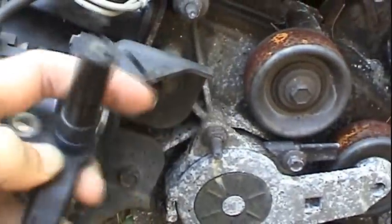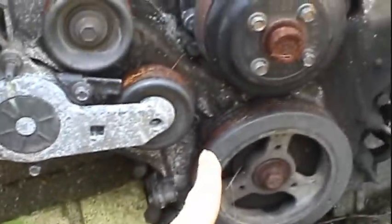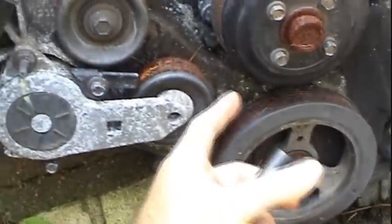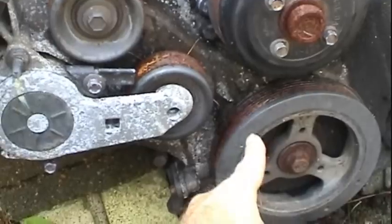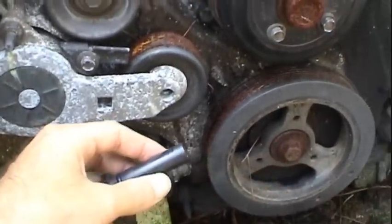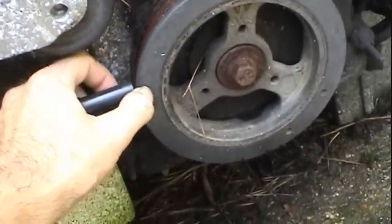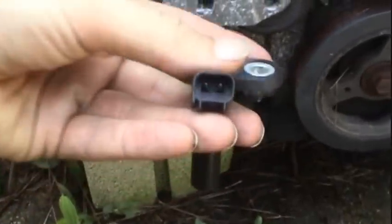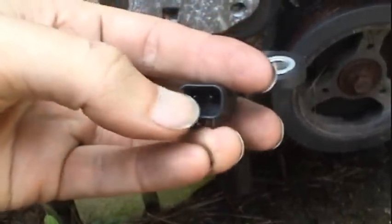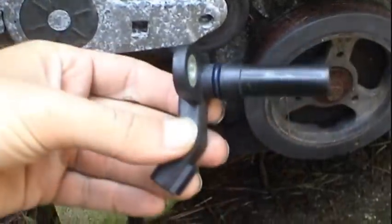It's just a magnet. And what happens is there's slots on a wheel inside the timing chain cover attached to the crankshaft, usually about 8 slots, and as those slots pass this magnet, the magnet is very, very close to the slots, it generates a voltage from these two terminals here. So this setup here is basically a signal generator,